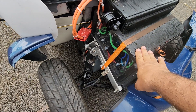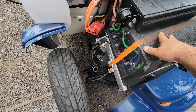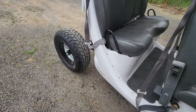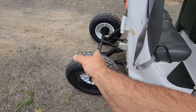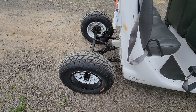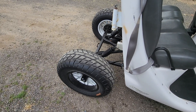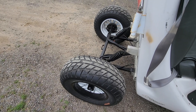I'm really glad I put the battery up over the front, because on this '02 GEM the front end needs the weight for the suspension or it will be really bouncy. With the batteries out of the back, it's a little bouncy back there — not too terrible. Extending the frame a little and leaving the shocks where they are would change the leverage on the back end and make it less bouncy, kind of like putting a longer handle on your ratchet.